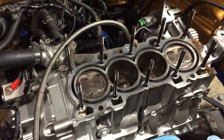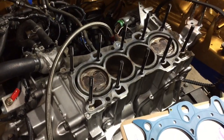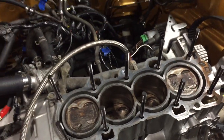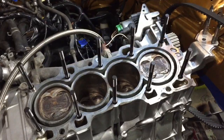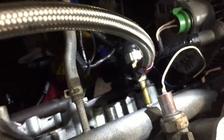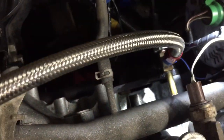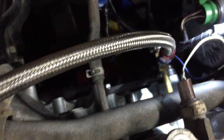There's a lot of questions out there about the B20 VTEC, so I'm going to clarify it in one minute. We put the VTEC line here — you could do a sandwich plate, but we did it from here just because it's more pressure and it's clean oil. You will get dirty, grimy oil from the other location, so that's my preference. There are three scenarios when doing a B20 VTEC.